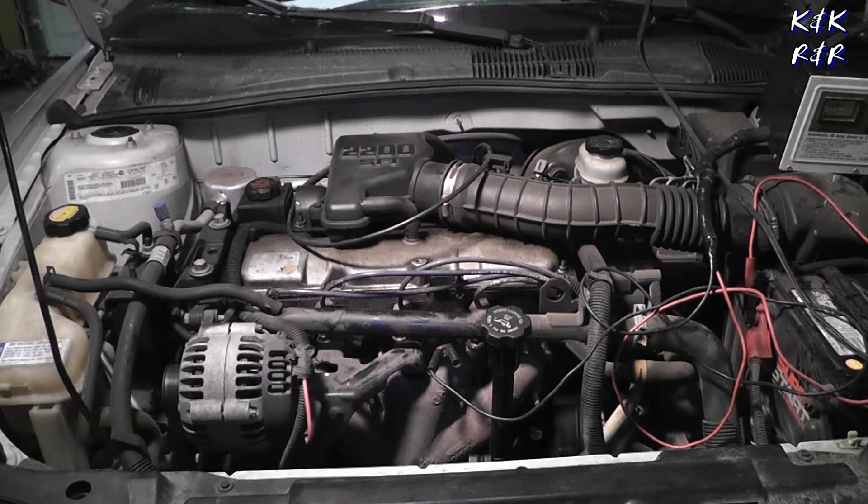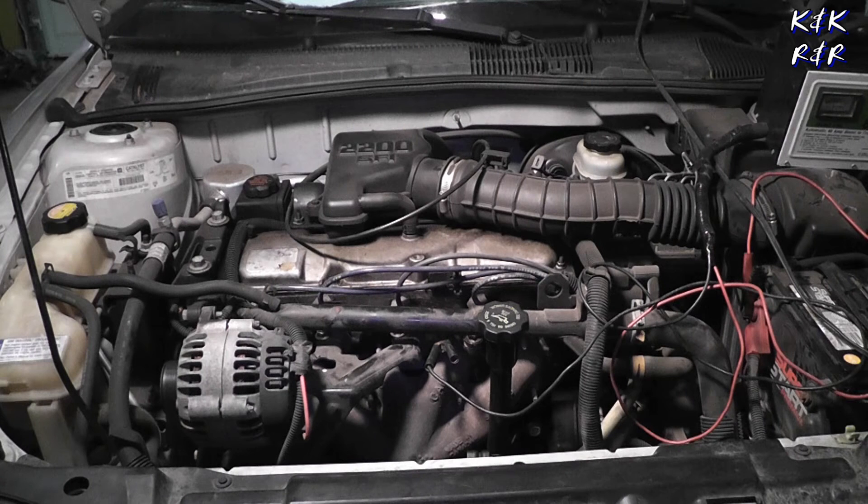Normally when I've seen timing chains break, what I'd hear would be the opposite — you'd actually hear the motor spin up really fast, like a 'woo,' and this one is not the case. So unfortunately we're going to have to do some teardown inspection. Take the valve cover off and see if we have valves turning — that's the easiest way to diagnose a bad chain. I need to see what those valves are doing.